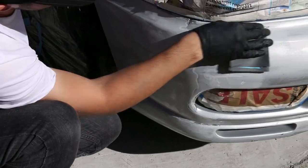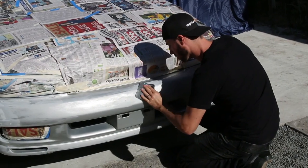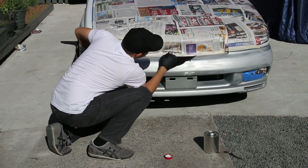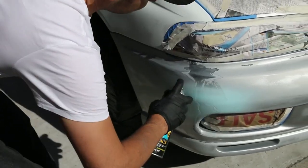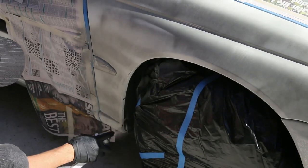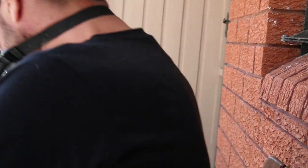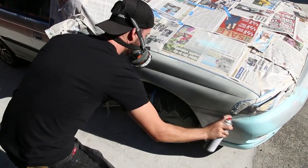Next up, we're going to rub back the old paint. The idea is to get rid of any obvious edges, as they will show up under the finished paint job. Next, we're going to clean the bar with wax and grease remover, and then spray on the filler primer over any damage. Our guard is undamaged, so we can paint the primer straight onto the lightly scuffed panel. You can use really fine sandpaper or scotch-brite pads to roughen up the surface. Build up the layers of primer slowly so you don't get any runs.